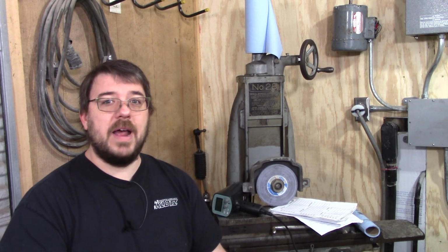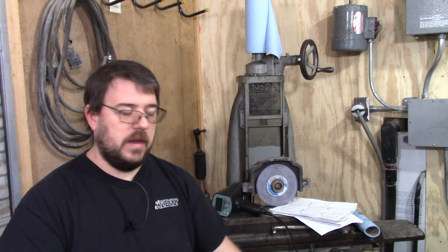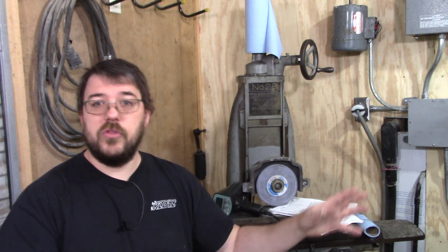So I'm going to go on the assumption here that maybe there was a shipping mistake and these stage 2 cams are actually stage 1 cams. So I'm going to ignore the lift discrepancy and the duration discrepancy, and we're going to explore center lines from now on. But the really nice thing here is we can use the power of the crowd.